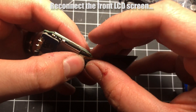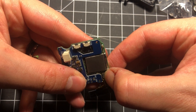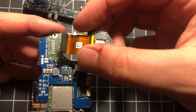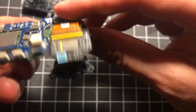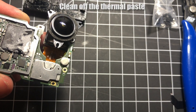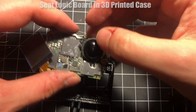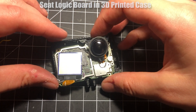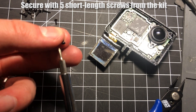Now we're going to seat the GoPro logic board and BEC into the 3D printed case, but first we need to reconnect the LCD ribbon cable. After that's reconnected, we've got to reconnect the camera sensor cable. I needed to clean off the thermal paste as well — be careful doing this so you don't get it on your hands and then on a connector. Before you seat the logic board in the case, give it a good press from the back to make sure the connectors are still in there securely, and then it should just sit in the case nicely.